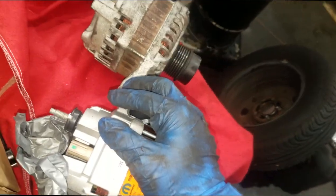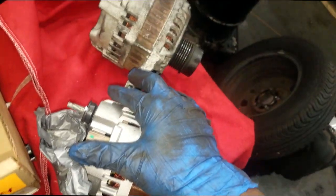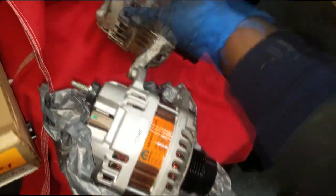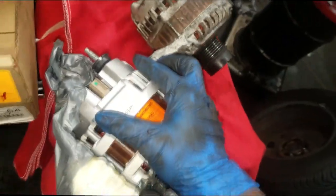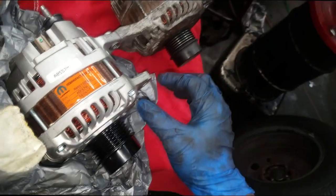Go ahead and run your electrical system diagnosis all over again. Okay, load test the battery, verify that the alternator is charging, verify that the starter is not pulling an excessive amount of current when it's cranking the engine. And this should turn out to be a successful repair.